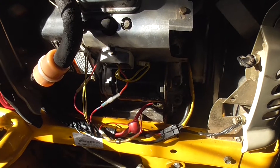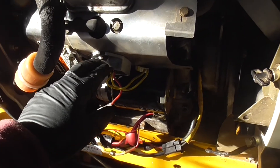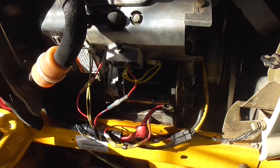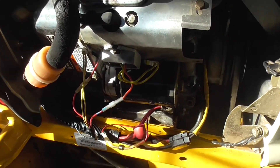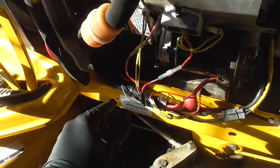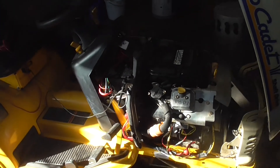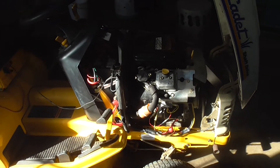I also want to mention that a lot of times rectifiers aren't grounded properly, so they won't charge the battery if grounding is an issue. That's something to look at if your rectifier and stator are both testing well but you don't have power. You also want to check this red wire, which leads up to the key switch and then to the battery positive terminal. Those are the things to look at if your Briggs and Stratton isn't charging. I'll put links in the description to the parts you'd need to replace.